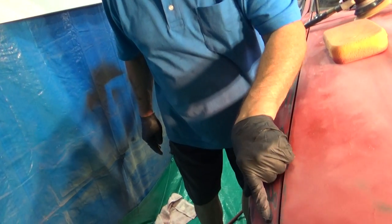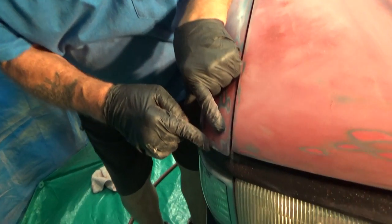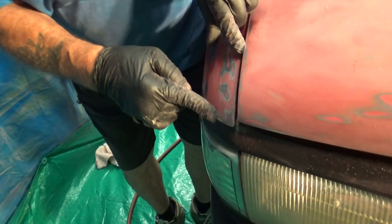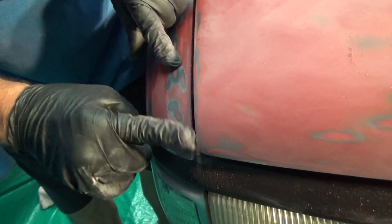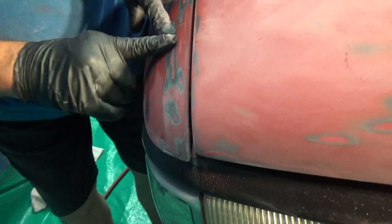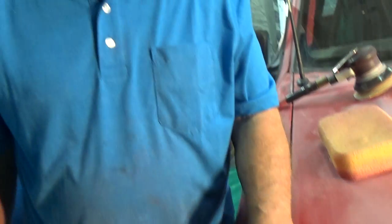By the way, these places I have gone through to the metal — I will seal that. Some people won't. Right here I've hit a spot where the metal shows — these are actually layers of paint and primer, so I haven't gone all the way through, but this is metal. I need that covered with a sealer, and I'll spot spray the spots that need it, because it just takes the paint better — it'll take the primer better, it'll look better, I'm able to work it down smoother, and it'll be a better job overall by doing so.